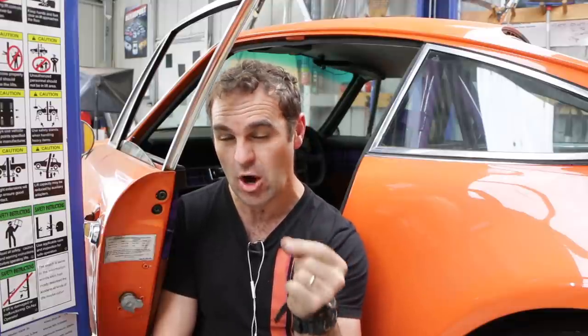I just spent the last 40 minutes adjusting that clutch pedal and getting the cable in a better position, and as soon as I used it, it slipped on the little fitting. I'm having trouble tightening it up enough to hold the tension, because obviously there's quite a bit of tension that goes into a clutch. Ultimately I absolutely have to come up with something else. So if anybody knows of a nice thick clutch cable I can use and where I can get one — I've been looking, but everything seems to be motorbike stuff and I don't know whether that's actually going to be strong enough. Anyway, I think it's time to move on to something else.